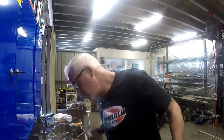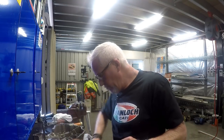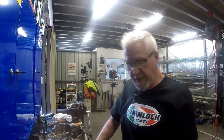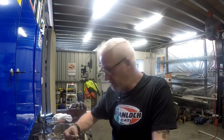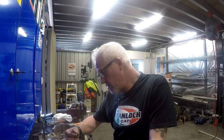According to everybody that would know, this is good news for you guys concerned about your own bikes — this is a rarity. I can well imagine it's a bit like an electric motor: they have a big bearing on the load side and often just a bronze bush on the other end. The load side for the bike is of course on the clutch side, so this is just holding everything in place with no massive load on that bearing. It has to have been either oil starvation, something gone through it, a creep death from a bad SKF bearing, or it was installed in a manner that damaged it.